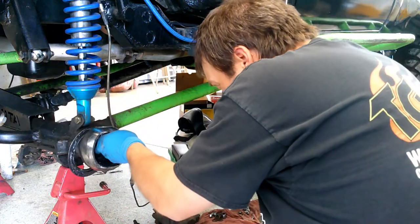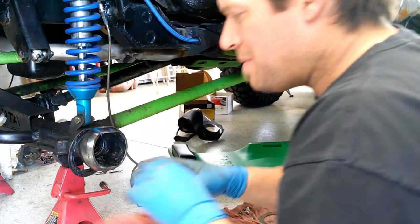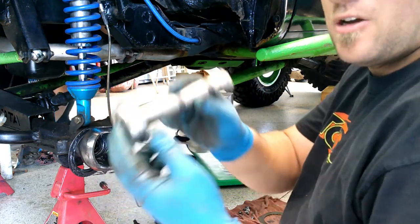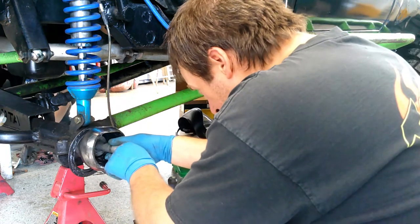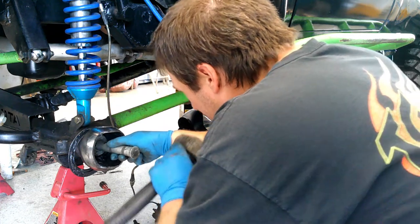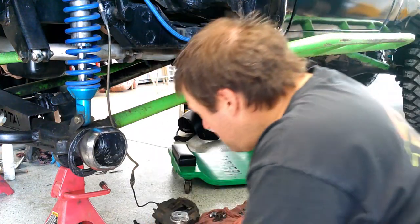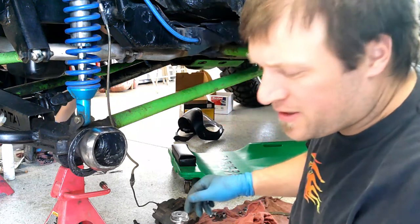The simple way to start is to push the new seal in so it sits and stays while you take a bathroom break or whatever else you want to do. I have a seal installer — it goes to this little aluminum punch, and they hook together like that. Generally there's a bolt that goes in here but I decided I'm not going to use it. Get your seal somewhat lined up, take a hammer — a real hammer works best in my opinion — and tap it in. The seal is in, looks good, happy and healthy. Moving on.